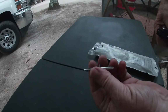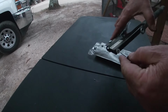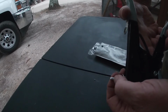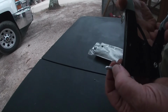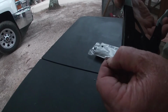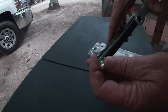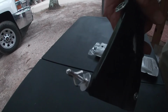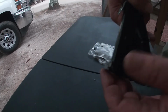All right. So let's take a look at these Molly rivets here. A regular rivet just kind of swells up right here at the end. But the Molly rivets act more like a Molly screw will, and this whole thing just expands open. There are slots in the rivet to allow it to do that. So let's take a look and see how this will expand behind the wall. Whoa, look at that. So that's what's going on behind the wall.